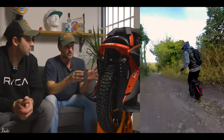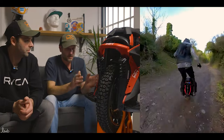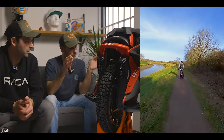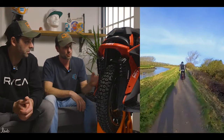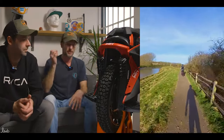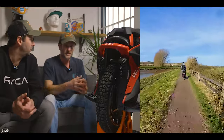They've got a lot of power out of the batteries which goes to the MOSFETs, which then goes into the wheel and translates into traction. They don't just develop the torque curve for ride quality — it's also to control the power spike to the MOSFETs to stop blowing the controllers. You don't just go 100%. And if you did give it 100%, what are you going to gain from that? So they've thought about how that power could be delivered in the best way — it's controlled by the MOSFETs but ultimately by software. It's by design.